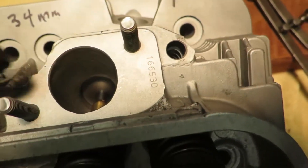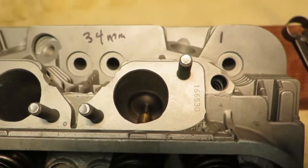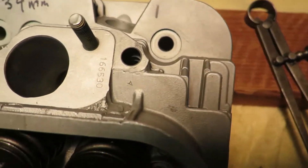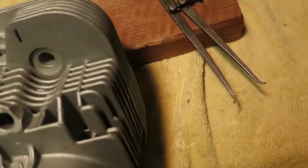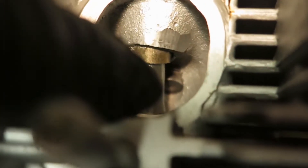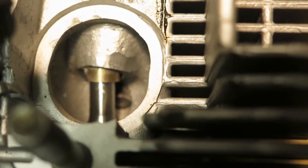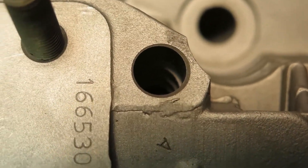Unfortunately the other heads have a lot of carbon on them so it doesn't show very clearly — these ones are a lot cleaner. I also wanted to show the EGR ports. I didn't know they were coming when I ordered these heads many years ago — it was a surprise. What are these? There are big holes in the EGR ports. Right behind the valve is where the exhaust gas recirculation smog pump connects. There's a screw head there — they screw in.